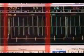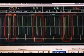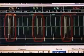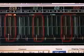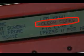To verify the repair, a scope is reinstalled on the crank and cam sensor outputs and the signal is monitored. Now the cam signal is observed every other crankshaft revolution. The diagnostic trouble code is cleared from the computer system and the vehicle is test driven for a complete repair confirmation.